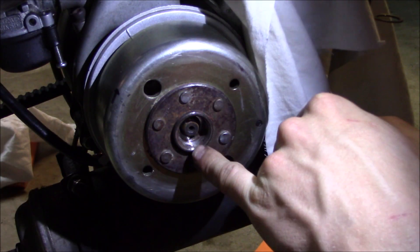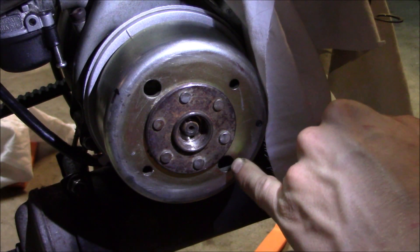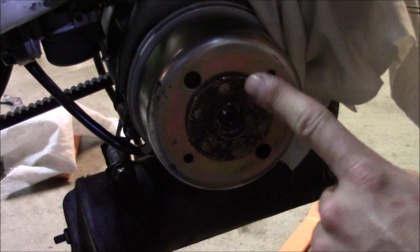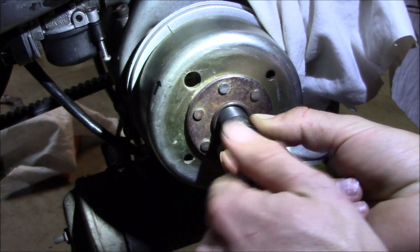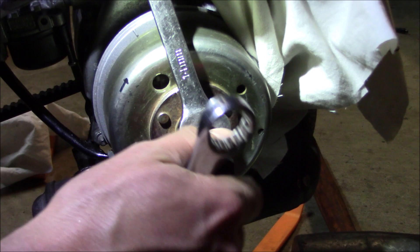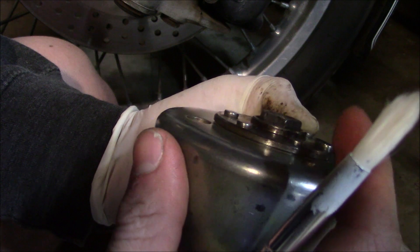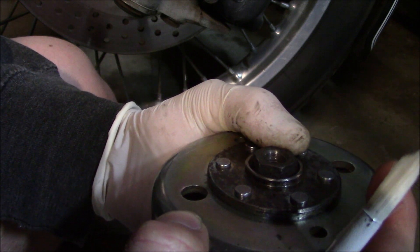What I did with the last one of these engines I built, I actually bored down the flywheel so that more of the crankshaft threads were exposed so that the nut would have more to bite onto. I have the crank, flywheel, and case marked and now I'm going to use my special puller to remove this. I milled down the inside about four and a half millimeters — I'll still have a decent amount of purchase area for the socket, and this will have a lot more thread engagement on the crankshaft.